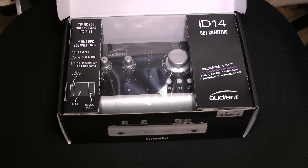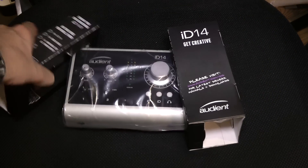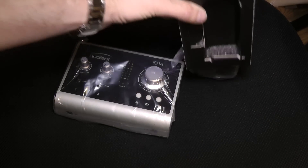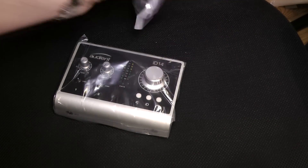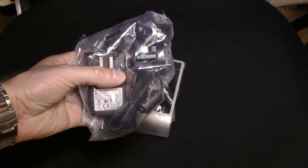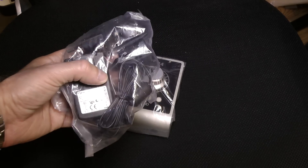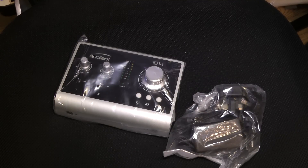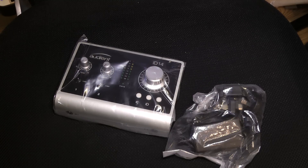So inside, it's business as usual. Inside here, USB cable — we're going to need that. And in here is the power supply with every possible connection for European, American, and British power supplies. The cool thing about the ID14 that we know back from Messe is that it is actually bus powered. You only need to connect the power supply if you want to use the built-in phantom power. So if you're using dynamic microphones or valve mics that have a separate power supply, you do not need to connect it up to a power supply.